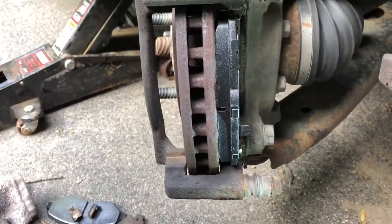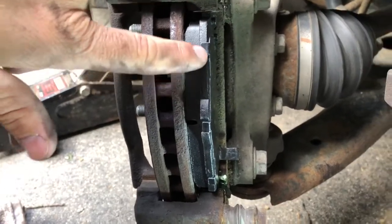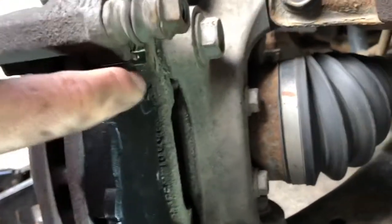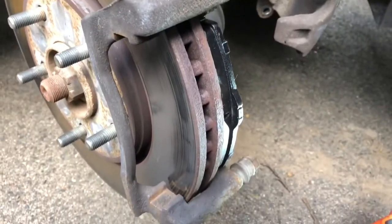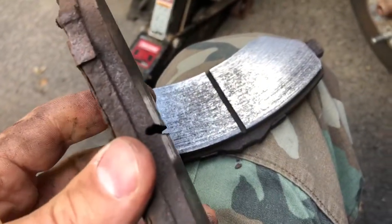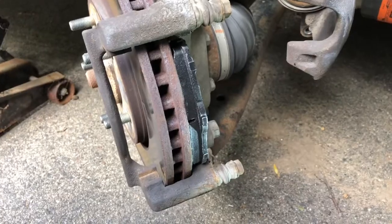Quick update — I'm doing the other side, the passenger side. The inside brake pad was kind of like the other side, tougher to get in. I cleaned it out as best I could before the clips were in place, then got the clips in, got the grease on, got one end in, and had to tap the other end with a hammer on that little nub. Something to mention: these pads were not the culprit for the squeaking sound either — you can see these have a lot of life on them, not even close to where the wear indicator would squeak. So if I'm gonna chase that squeak, it's not coming from these brakes. Regardless, we'll get the new brakes on.